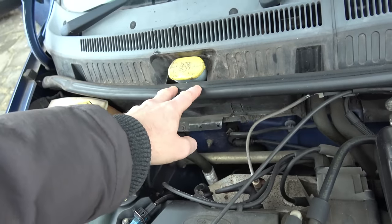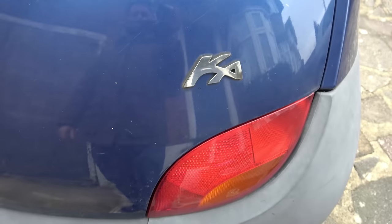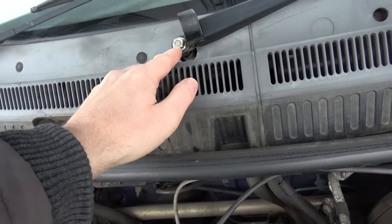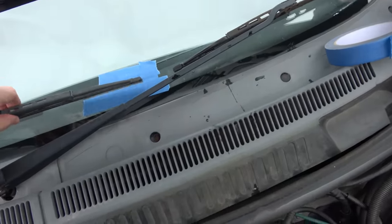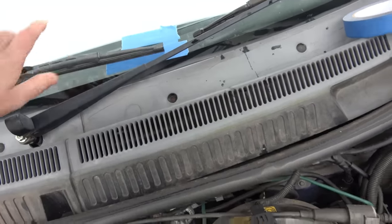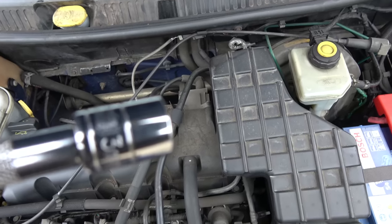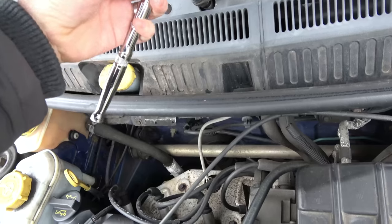The reservoir was already filled with water - that was the first thing done. In case you're curious it's a 2007 car and it's only done 45,000 miles. The first thing we have to do is flip these up and undo the actual wiper blades. To make sure they go back in the same position, my brother's putting tape around them so we know exactly where to put them back. The wiper part itself is working fine. For the wiper arms we need a 13mm socket - lefty-loosey.